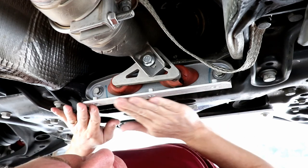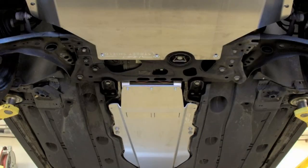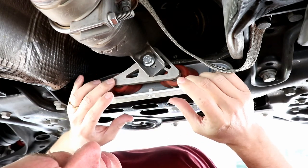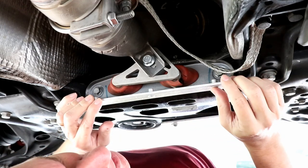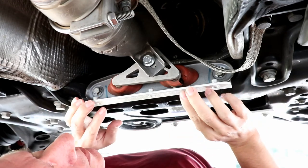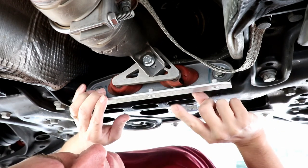What you see here is the ECS tunnel brace slash skid plate bracket. This will probably not be on your car unless you have the tunnel brace. When I first noticed this blown mount I had speculated that there was undue pressure on it and that's what caused it to blow out prematurely. A lot of folks in the MQB Facebook group mentioned that no, this is normal — they just blow out — and basically wrote it off since my car's got a hundred thousand miles on it. But then why didn't this other one blow?